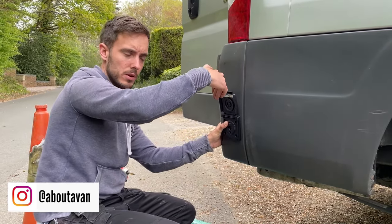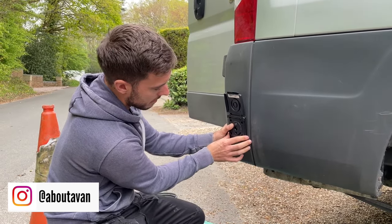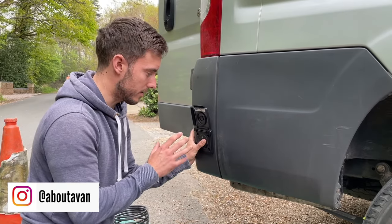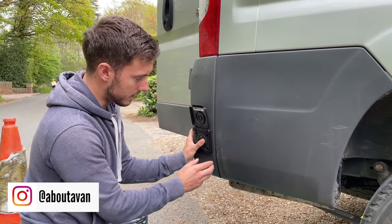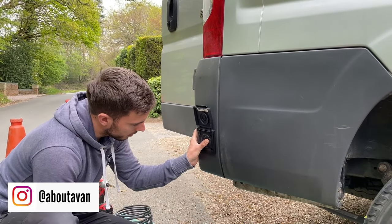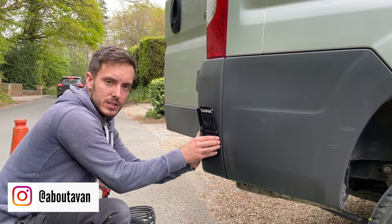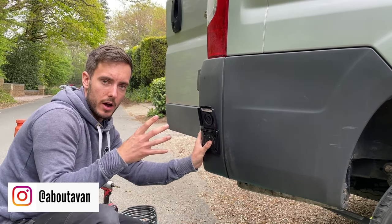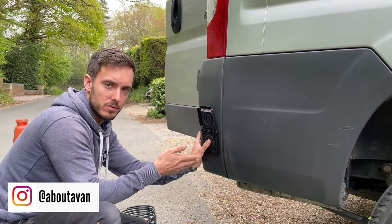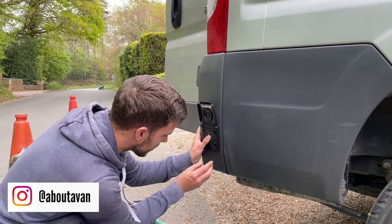You're not going to see the angle from the top looking down, but as you look at the vehicle side-on you're going to see that profile between this line here and the joint in the bumper itself. So now I've got this lined up with the side trim, I'm going to put my little drill bit back on the drill and go through and make two pilot holes on the top edge so we can get some screws in. Once that's secured in place I'll then make the bottom two, because it may move slightly and I don't want to make too many pilot holes in the wrong position.